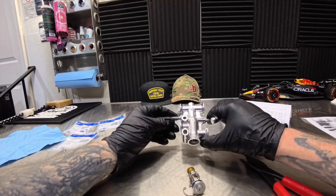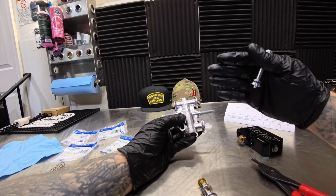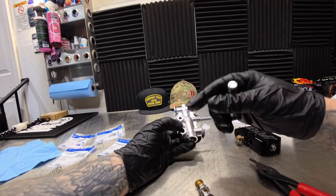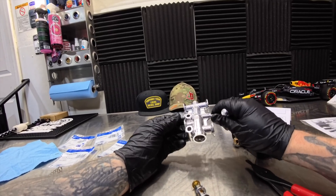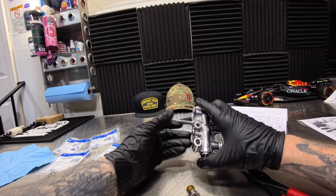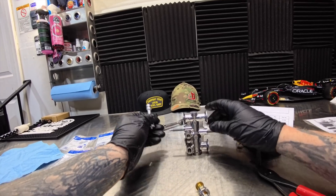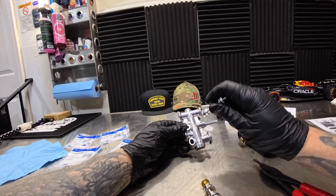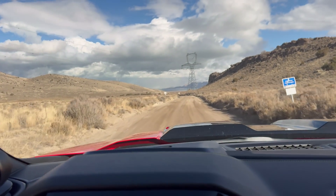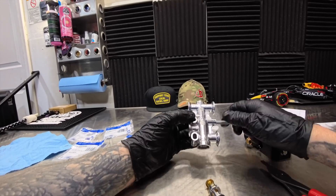In relation to the common problems with these 10L80 transmissions — the valve body issues — when you're seeing higher temperatures, fluid degradation is actually more likely than at around a 160 range. With fluid degradation, it starts to discolor and potentially cause some scoring within the valve body, and I believe that scoring is causing the valves to stick. So I believe this will help my truck long term because the fluid is going to stay in better shape — it stays cooler but not too cool, we'll get that condensation out, and when towing the transmission temperatures won't be way high. With the stock valve I was hitting 220 plus with just basic driving on a brand new truck, so this valve is going to play a good role in that.